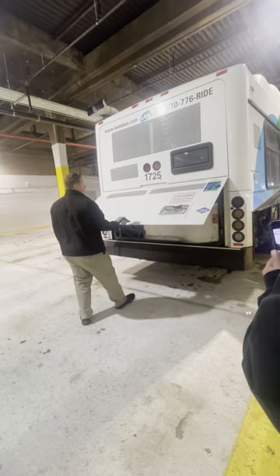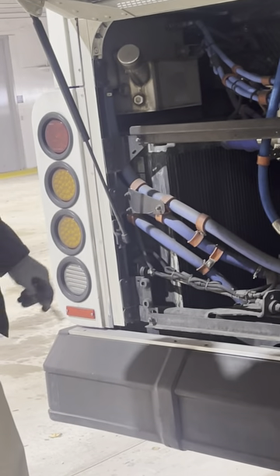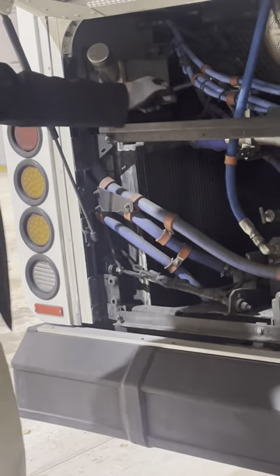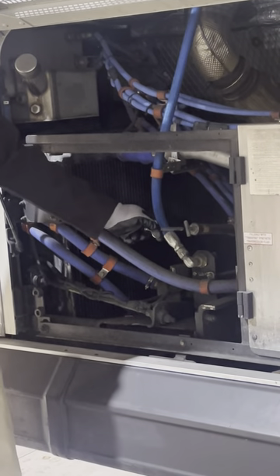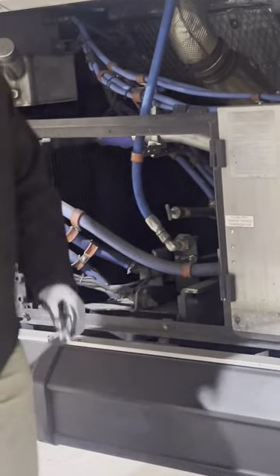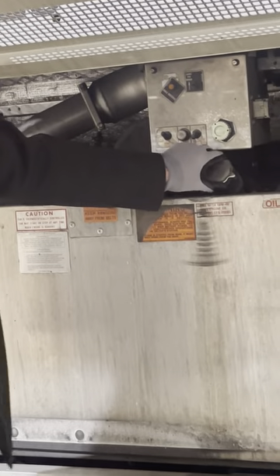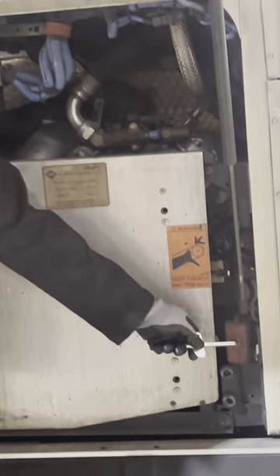Opening the engine compartment. The newer buses will be slightly different. Coolant reservoir has a cap, is not leaking, and is filled to the adequate level. Radiator is properly mounted and secure with no signs of soot indicating a leak. Hoses, wires, and clamps are properly mounted and secure — no leaks from hoses, no cuts or frays in wires. Transmission dipstick is properly mounted with no signs of leaks. Oil dipstick — pull it out, clean it off, put it back in, then pull it out again to check the level. Diagnostic box is what mechanics use to check error codes. Oil fill has a proper cap with no signs of leaks. Two gauges on the right side will be functioning when the bus is running. Battery jump port has no signs of corrosion.